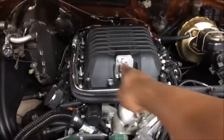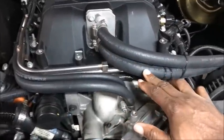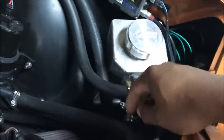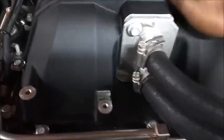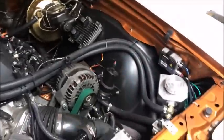One more time from the top — this is how I routed mine. Hot fluid comes out through this line and goes to the inlet of my reservoir. Out of the reservoir it goes into the pump, and out of the pump it goes all the way through the firewall — you can see that — to the heat exchanger. That's where it all gets nice and cool. Then it goes out from down here on my heat exchanger, through the firewall, all the way back — cool liquid goes back into the top. That's the simple route I went for cooling my LSA.